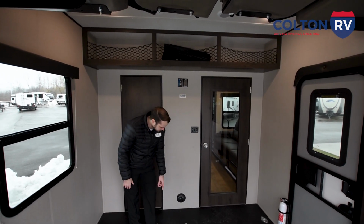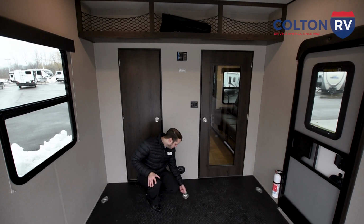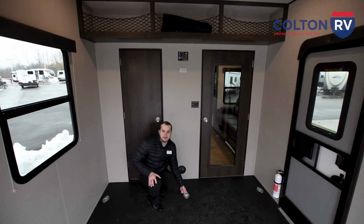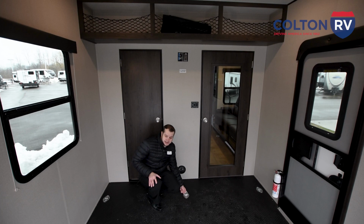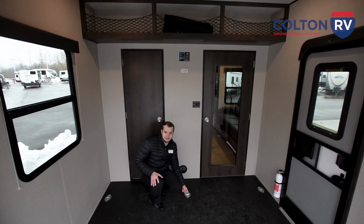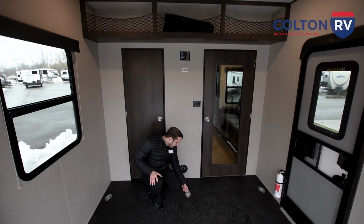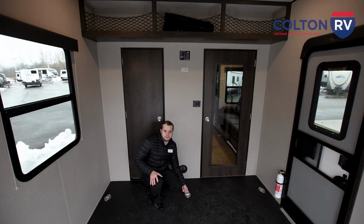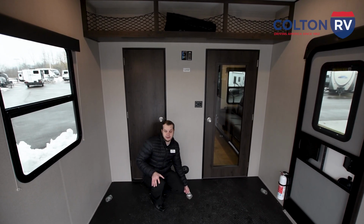So all the tie downs, these things are actually secure in the chassis itself. Now you might be wondering, why is that important? Well, if you got a 500-600 pound bike back here, you'd wanna know that these tie downs are secure to the actual chassis, versus just the floor itself, which, the tie downs might have a rating, but realistically, the floor itself has a little bit less of a weight rating in order to rip it up out of the floor, but not in a Grand Design.